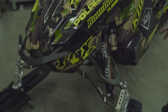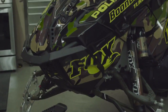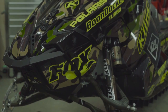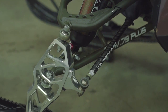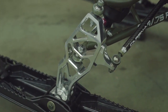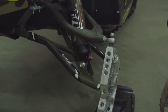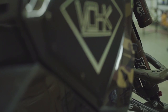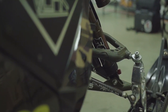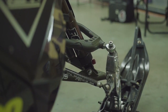Coming down to look at the Skins Extreme Front End — this is the front end that Brandt has been working on for a few years now. Super lightweight, you can get it in either chromoly or aluminum lowers with aluminum upper arms, carbon fiber steering rods, full billet spindles drilled out — super trick looking. I've got the custom army green powder coating they did for me. The front end shows all the caster built in, helps with bump steer a lot, and the A-arms push the spindle three-quarters of an inch further forward. It's 37 inches on center.